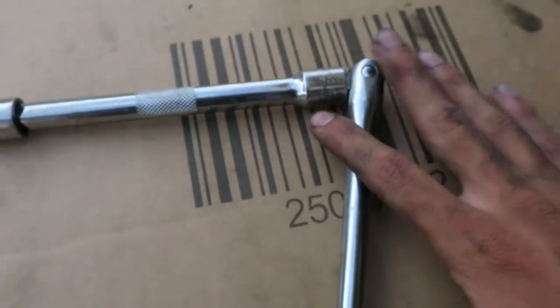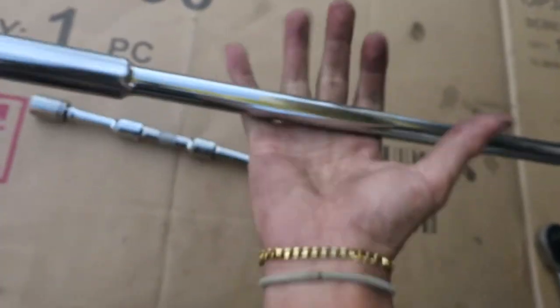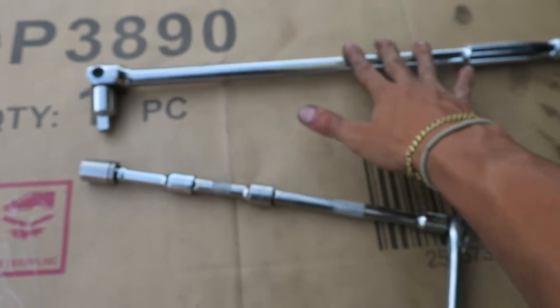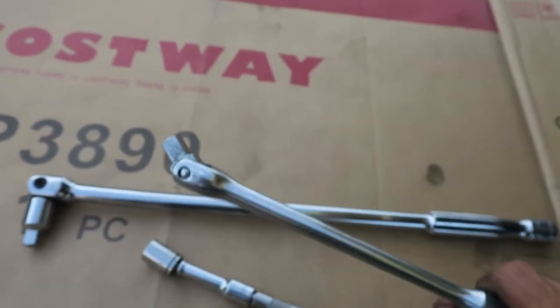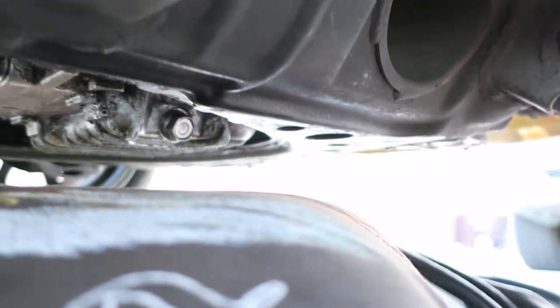This is the exact setup I used to break the bolt: 14mm onto this little swivel-head extension, then a 3-inch, then a 6-inch extension with an adapter, then the big breaker bar. After I cracked it loose with the big breaker bar, I moved on to the smaller breaker bar - this is really heavy and takes up just about the exact space I have underneath the car. After one crack with the big breaker bar, a couple more cracks with the little one, I was able to take them out by hand. I stick my hand up to put a hand on the nut to guide it in with my right hand, and with my left hand I'm turning. You can see the very little flex you need on that socket - all the torque is still straight through the extensions.